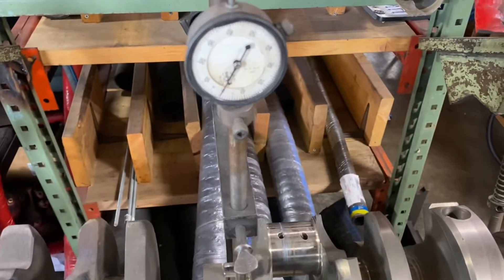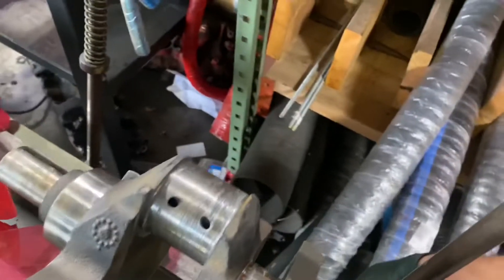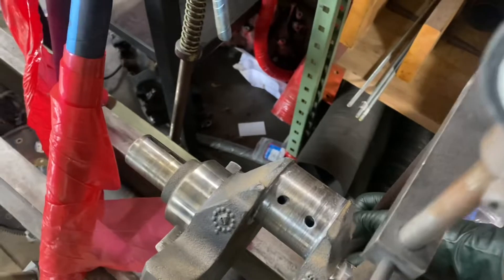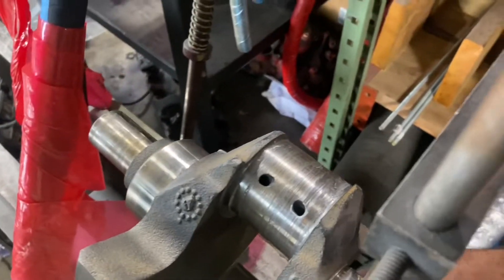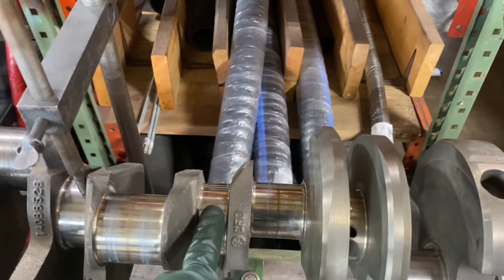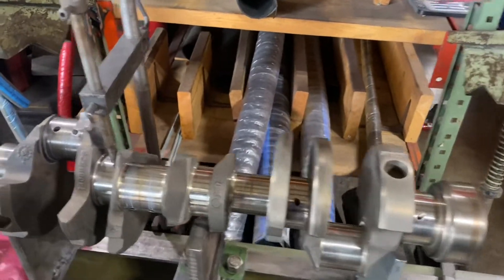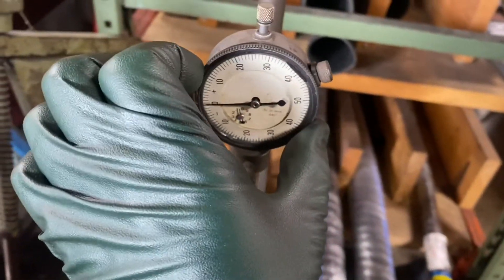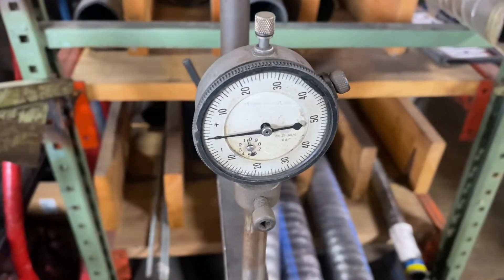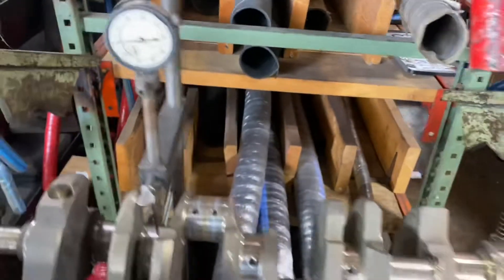It's almost dead nuts just with a hammer and chisel, but it's got to be straight. I did not strike over here, but you saw how it was bent eight to nine thousandths here and ten to eleven thousandths there. All the striking right here actually relaxed the metal throughout the entire crankshaft. Checking the dial — rotating it — pretty good, it's damn near zero. We are in good shape, we can grind her up!